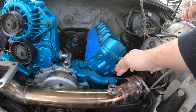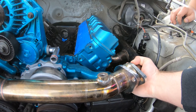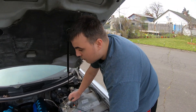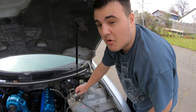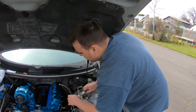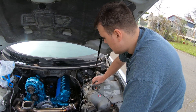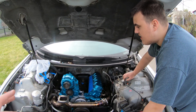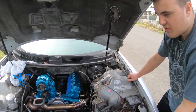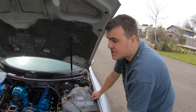There's also just the water pump inlet that comes right there. It's really going to be much higher up — everything's going to be tight. We're also going to have to rethink the spark plug wire routing. We want to come from underneath now that we have a manifold up like this so it doesn't burn a plug wire. We've seen some Kevlar sleeve stuff you can put on the spark plug wires. We just want as much protection as possible — we don't want to burn through a fuel line or anything. We want this to be as reliable as it can.